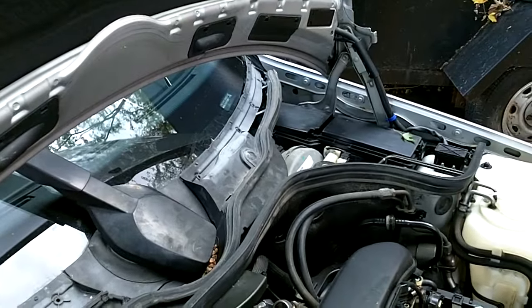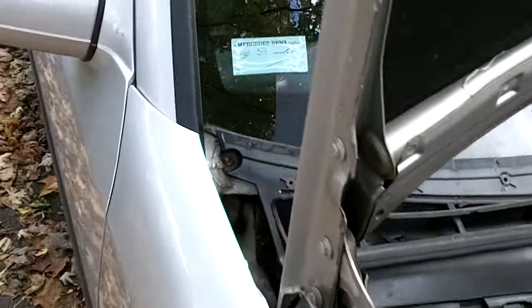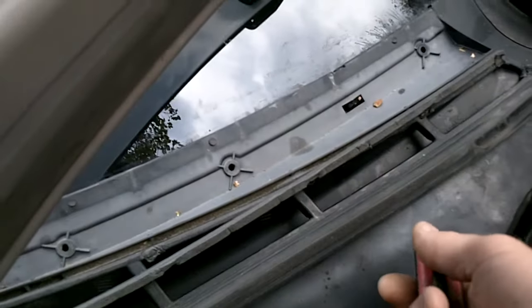Once you have all the Phillips screws and the 10 millimeter nuts off, there's a bunch of clips on the bottom — you can see them inside here. They're a bit of a pain; there are a couple that are really hard to get to. The easiest way to get these clips off is — reaching underneath and pulling up is kind of a pain — but if you take an awl or a sharp screwdriver, stick it straight in the middle and pull up, they will pull out.